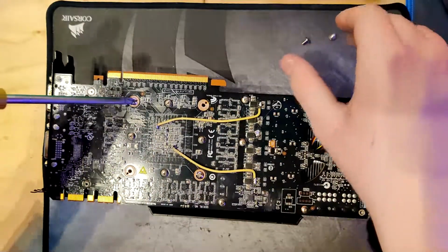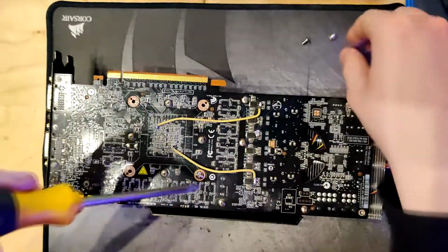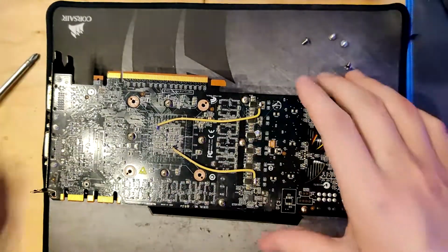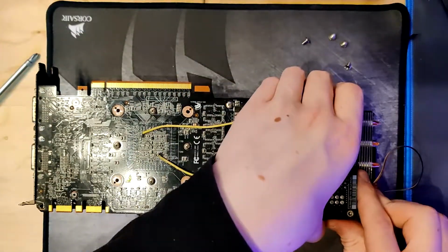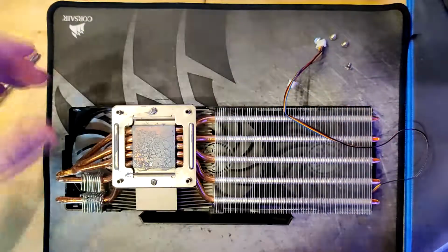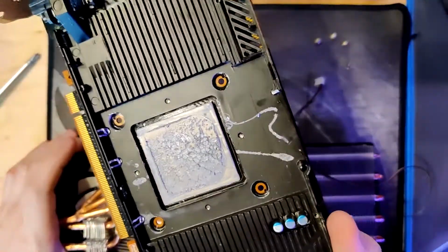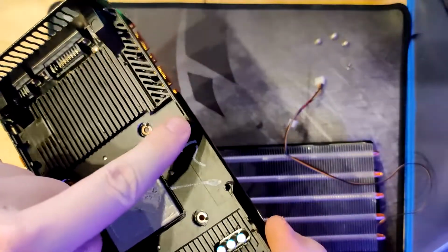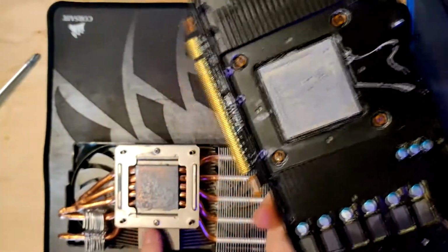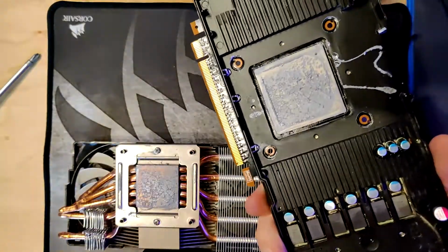The issue was that originally the heatsink would not fit because there would be things in the way of it. I'm gonna show you that right. I'm removing the heatsink. Ah, yeah, so gotta take the fan out. So there was a couple things. There was one metal piece right here that stuck up a little bit that would collide with this mounting plate. Actually, all of the things that I needed to take care of would collide with this mounting plate right here.